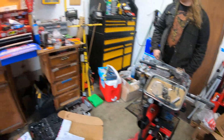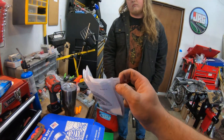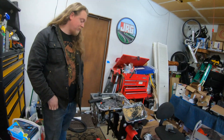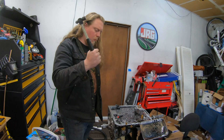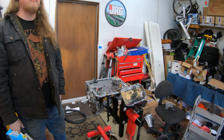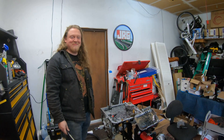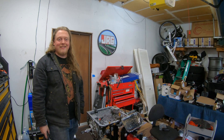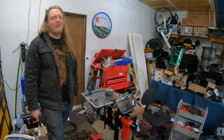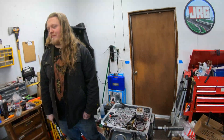There is some more stuff it did come with for the input drum. Not saying we can't do that later — we haven't put this in the car yet so we can still do it. I'll do some more reading into it. Basically we'd just need to take the pump off, take that out, take the input drum out, and put those things on with the springs. Which would actually require us to take all the clutches out again too, which would be really annoying.